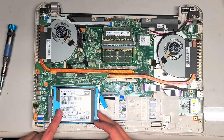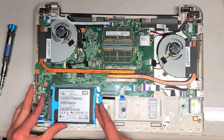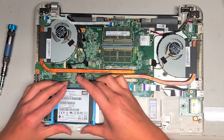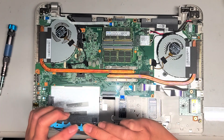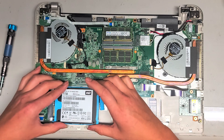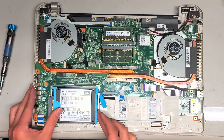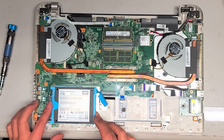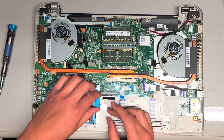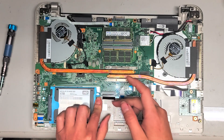So that's pretty much it. Slide it in — this side has to go down first, then you push it in. Then you can slide this down. Be careful because this rubber piece can get caught on stuff, so get it in between the two slots. Slide this in and push this rubber piece down behind here, and that will hold the hard drive in place so it doesn't come out.